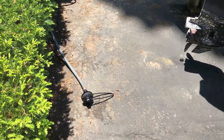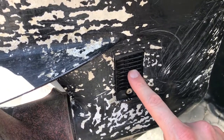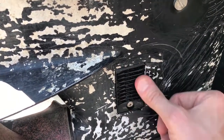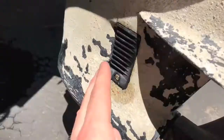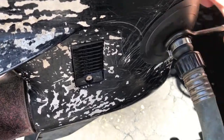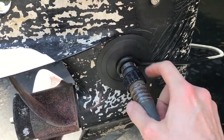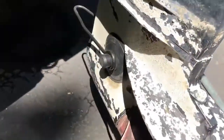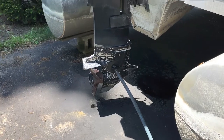The first thing we want to do is hook up the garden hose with the muffs on the lower portion of the outboard. You have the inlet vents that the water is sucked in by the impeller to properly cool the engine — make sure that these are clean and clear on both sides. Grab the muffs and position them over each vent. The muffs will be properly positioned when you cannot see any portion of that inlet vent on either side of the lower unit, and the hose is positioned so we're not going to trip over it and it's not near the prop.